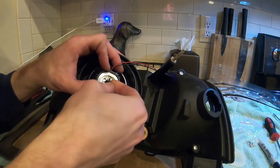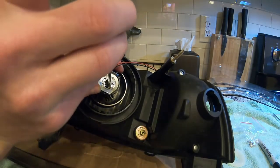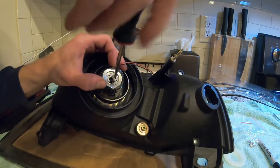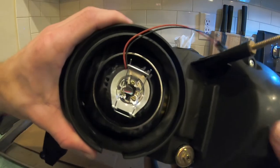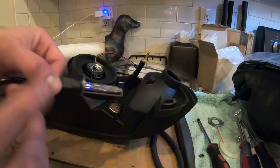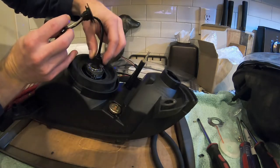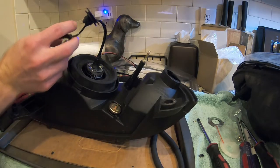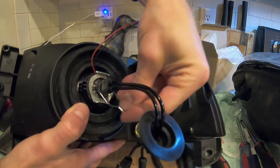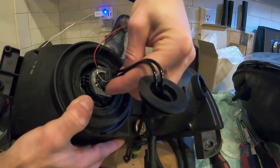We got it tightened down - it's pretty solid in there. The silicone ring actually acts a bit like a lock washer. You want to get that nut threaded on enough that the threaded portion of the reflector bulb hole is protruding up above it, because for the HID bulb to be retained we'll have to reinstall the little piece with the wire clip that holds the bulb in place. Now we've got our H1 HID bulb - slide it down into the projector and then come in with the wire clip that holds it.